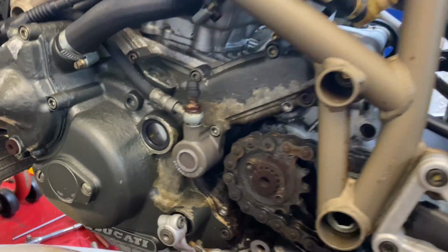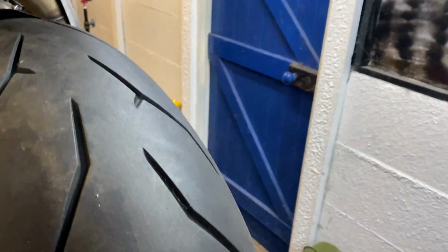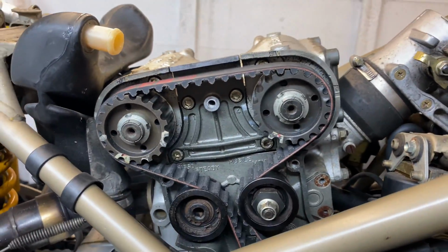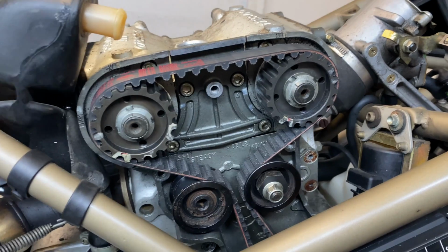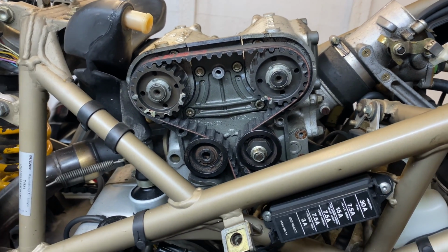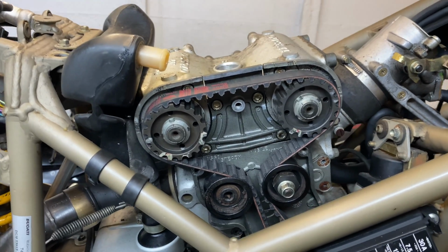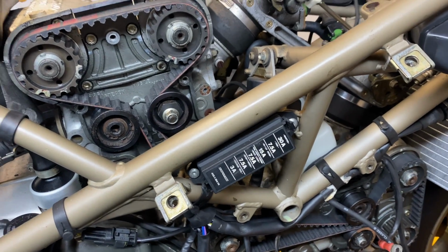So now round at the sight glass, you rotate the engine roughly 270 degrees and you'll come up with another dot. Now on this one, nothing lines up anymore, but we're not doing it for alignment. It's just to make sure that there's none of the tension in the sprockets when obviously you do the tension on the vertical cylinder, which we'll do now. And then I'll rotate it all again by hand, line it back up, make sure everything feels good on the tension, and it'll just be a case of putting it back together, doing the oil service and firing it up.